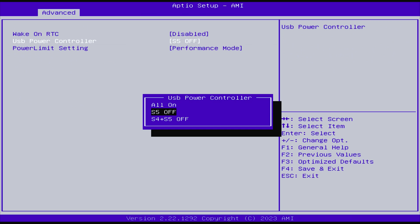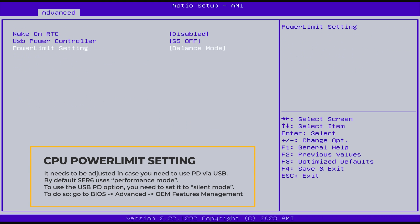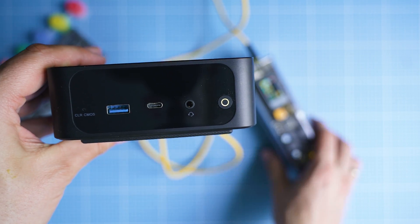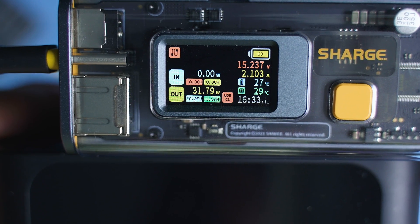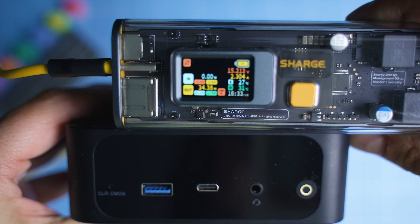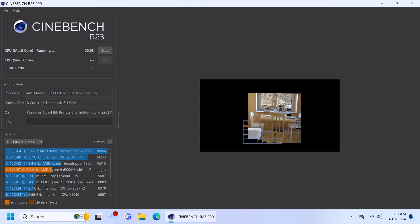You have to be careful if you want to use the USB 4 port on the back for power delivery — PD3 is supported for that purpose. Make sure to get familiar with the BIOS prior to that, because you might have to go into the CPU settings configuration. Some more parameters are configurable too. This newly adopted feature has worked totally flawlessly and makes it easy to carry the mini PC without its power adapter, as long as you have the right kind of power bank.